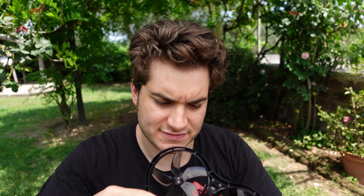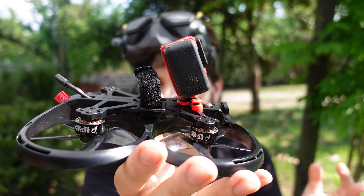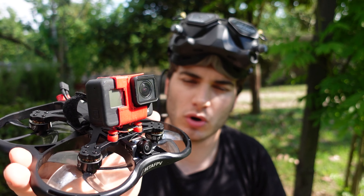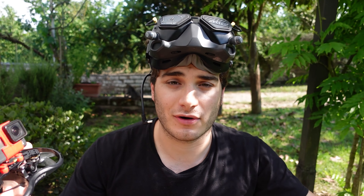Are you ready to see something super weird? I tried mounting a full GoPro on the dampeners and it looks fine until you move it — it wobbles badly. BetaFPV doesn't specify how to mount a full GoPro, and the dampeners are too weak for it. You'd need to mount it directly on the drone with a specific dedicated mount, which I'm not going to bother designing. If I go slow it shouldn't move too much — let's just see.